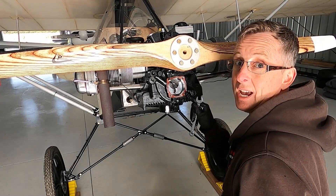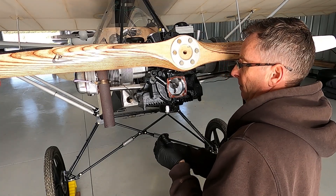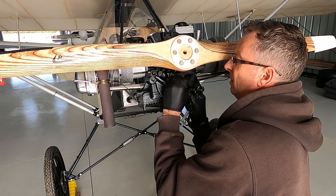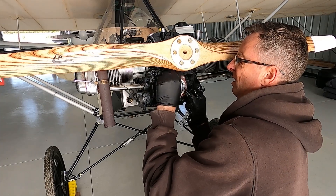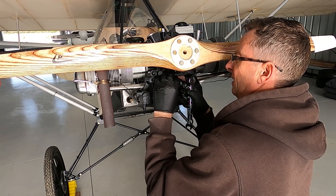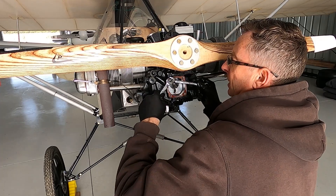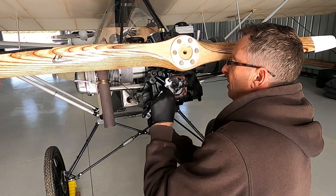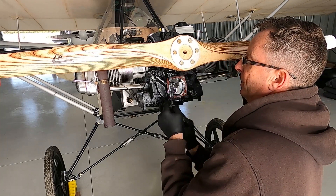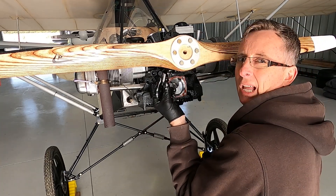The first two studs came out when I took the cover plate off; this one I've just pulled off now. It's really very simple — two nuts. One on, go about halfway; second one on. Tighten the top one down onto the bottom one, and then on the bottom one, undo it. Last stud extracted.